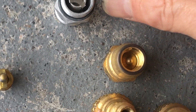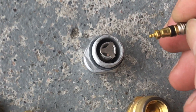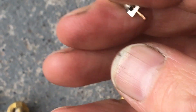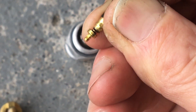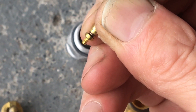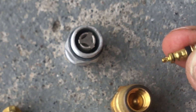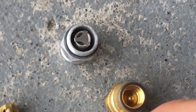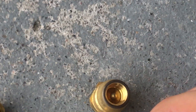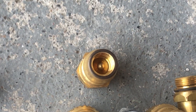The area where the refrigerant flows — that whole outer diameter is your refrigerant flow. You see the difference? That whole inner diameter on this thing opens up when you push on it. See how that pushes down — where that little gap is, the refrigerant hits against it and there's a stem inside restricting refrigerant. That's what happens when you try to pull a vacuum through a quarter-inch fitting. But we don't use these anymore in automotive, so we're using something with a hole this diameter instead of a little restricted thing like that.